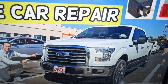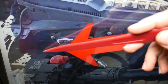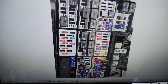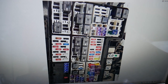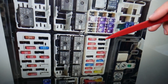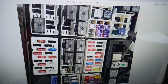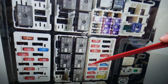Next, you need to open the hood on your Ford F-150 and locate the other fuse box, which is right behind the car battery. Open that cover and you will see the layout right there. Here we'll need to check multiple — three more fuses and two relays. The first is fuse number 21 — so if you have that option, it will be 21A and 21B, two fuses for the left and right headlight depending on which headlight option you have. After that, check fuse number 41 — that's 38, 39, 40, 41 — that 10-amp fuse will need to be checked.